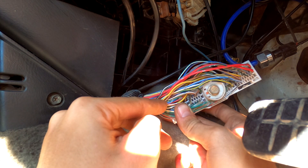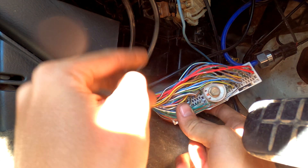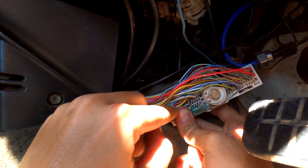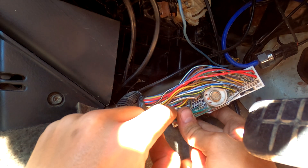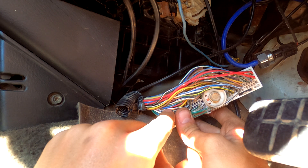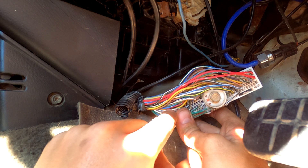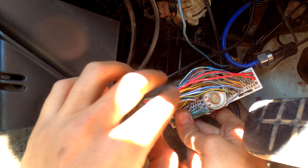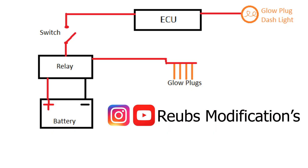You want to push the wires out of the way so you can pluck this one out. You're going to cut it and splice into it — send one wire up to the switch, send another wire back down and connect it back in. This will disrupt the relay. It doesn't have to be a thick gauge wire because it's not actually doing the glow plug amperage — we're interrupting the relay.